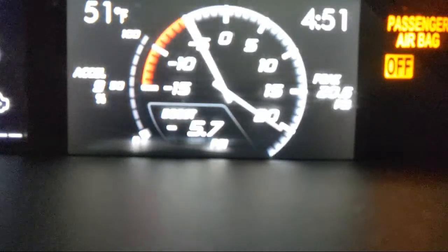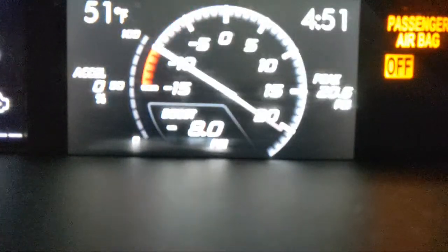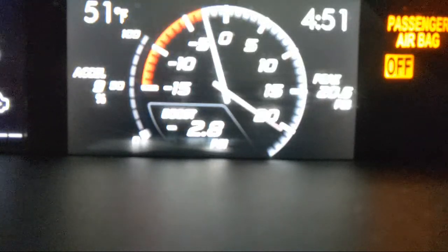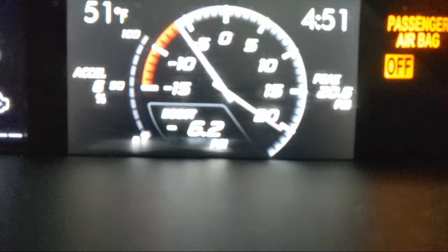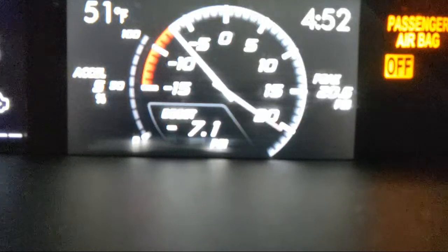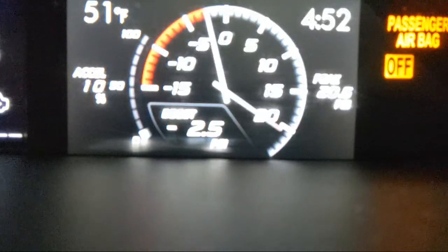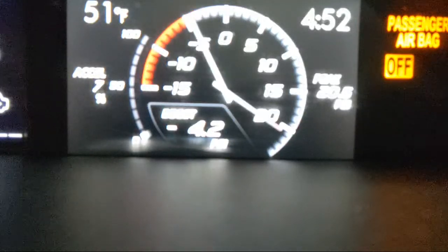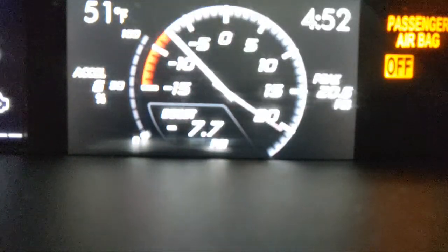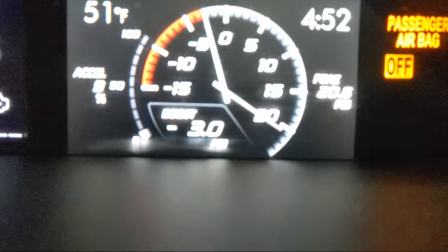The issue is that the block is not rigid enough, and the mains straddle a very large bore. And when those mains straddle a large bore, the mains are not strong. They deflect and they dump oil pressure from the mains, which therefore starves the rods. It has nothing to do with the gallery size. It has nothing to do with how many turns it makes. There's plenty of oil there and available. The problem is the block is just not rigid enough. So you've got to fix that rigidity issue.